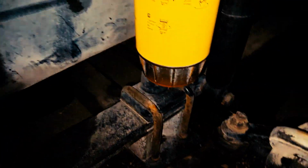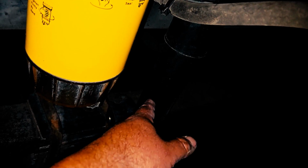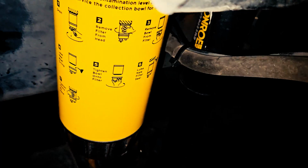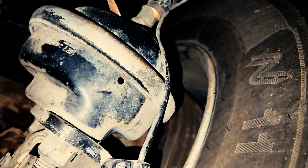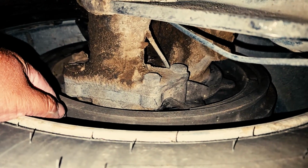I will then move into my shock absorber and shock mounts. Make sure they're properly mounted and secured. No signs of any damage, not cracked, damaged, or loose, nor are they leaking. I will inspect my brake system to ensure it's properly mounted and secured, and free of any contaminants. My brake pads have no less than 1/4 of an inch of brake pad.